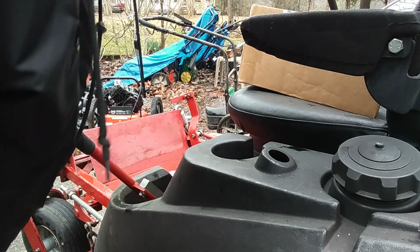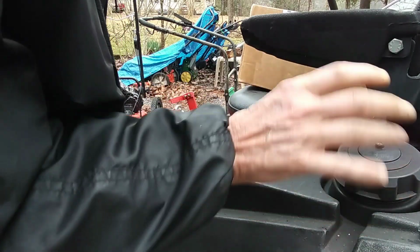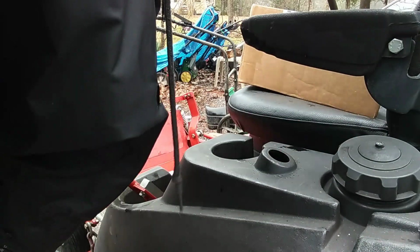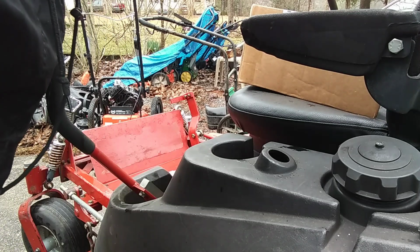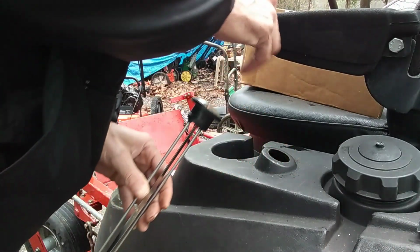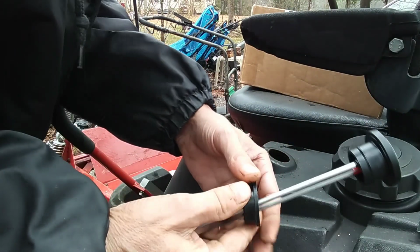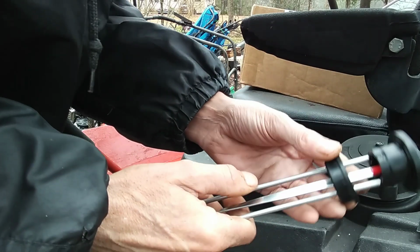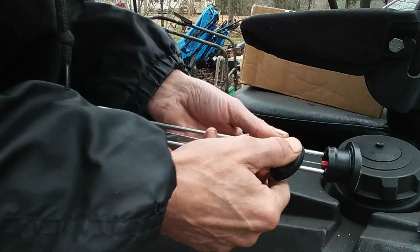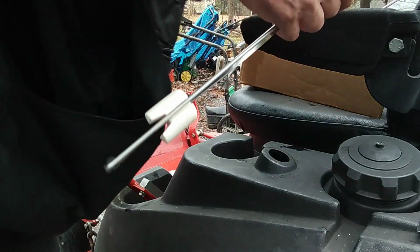May wait till we fill the tank up, because that float should float up to the top when we fill the tank up, and then we can just reach down in there with a pair of pliers or something and grab it, get it right out. So, hold on. I looked in the tank, and all that's in there is that float. So this fuel gauge, they've already put the grommet on there for me. I think you can take this off as one piece and just put a new grommet in if you wanted to. I'm not positive.